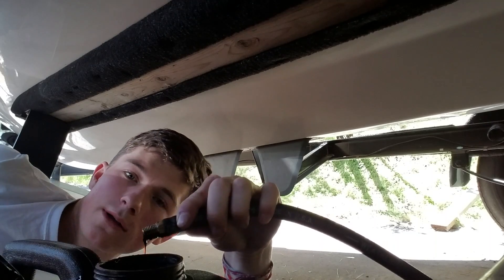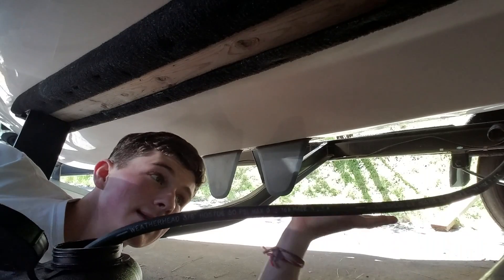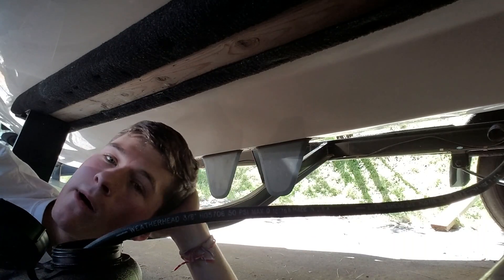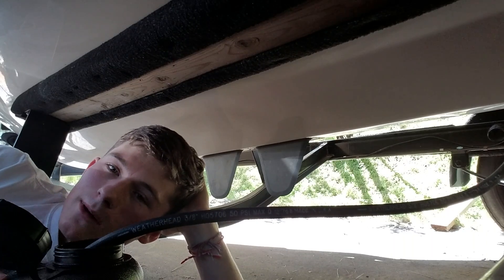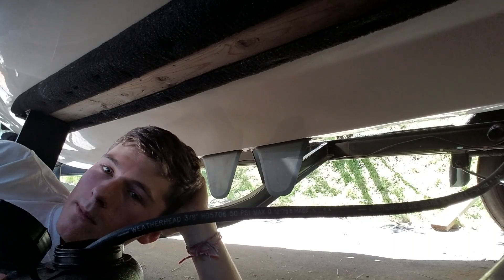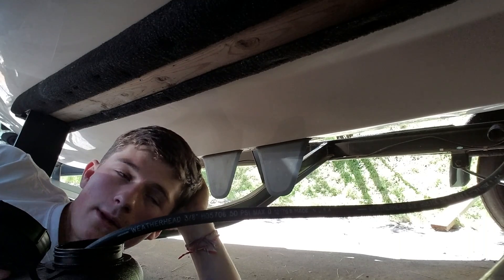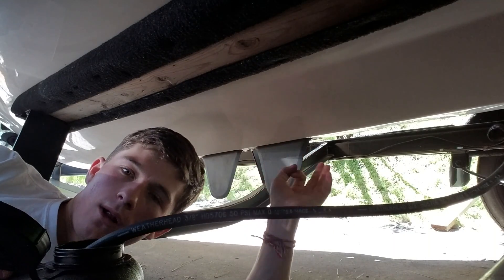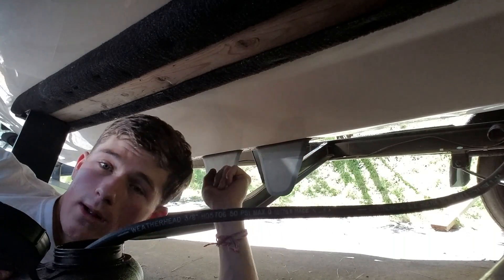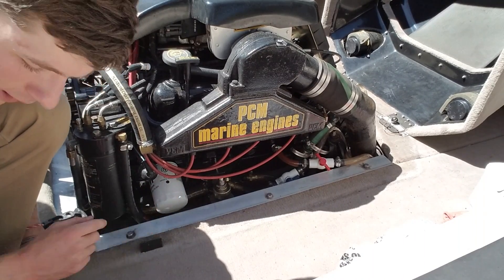You can see the oil is dripping very slowly because it's coming out of a hose. Make it slope so it flows out, and wait about 30 minutes to let it fully drain. Because it's draining through a hose rather than directly into a drain pan, it takes a little extra time. Taking that extra time is good to get most of the oil out. Next part is removing the oil filter.